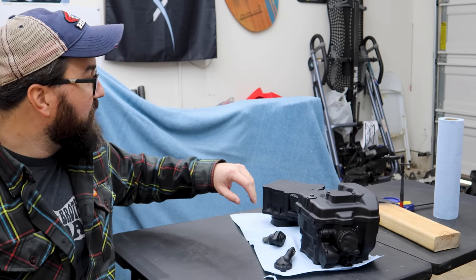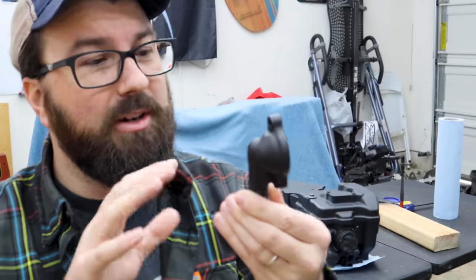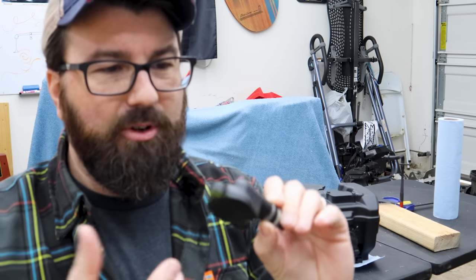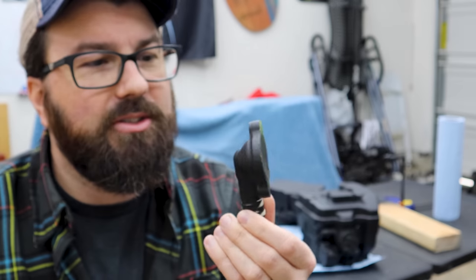It's been almost a day since we painted all the parts — just gave them a good chance to really cure up and dry. And the finish on here looks amazing. It has a very factory finished look to it; it feels like it and looks like it. Definitely gives the impression this will hold up for a very long time. This product really does lay out really well — it doesn't glob up or get runny. I have zero runs on anything. If you wanted to match the factory kind of gray it was, I think you could just do the primer, a couple of coats of that, then throw a couple of coats of clear over top. When the primer was wet, it looked just like the factory coating. We didn't put any clear over this because the clear isn't any more robust than the normal paint — it's just better to add extra layers of the main paint. Plus the clear would add gloss, and I wanted that satin kind of look.